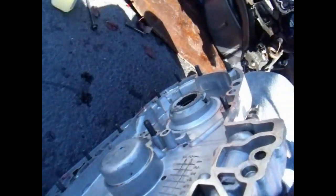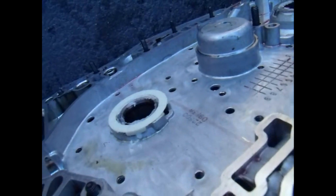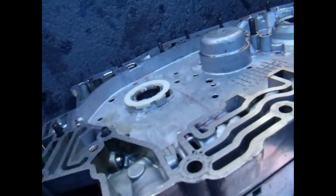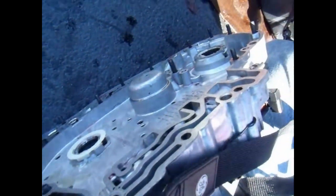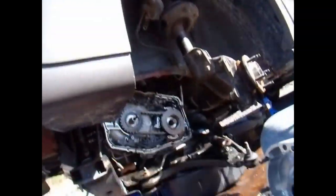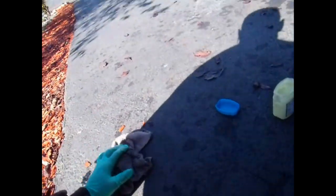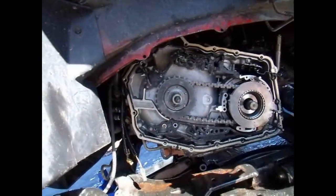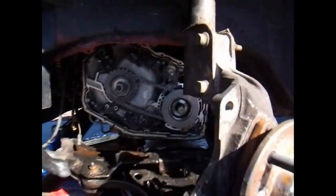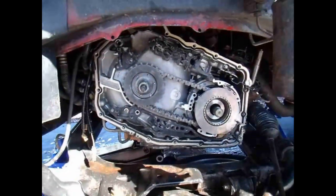As you can see, I've got my two thrust washers on the back of the case cover here, and I'm going to go ahead and put the case on — it's ready to be installed. This kind of gives you an overview of what you're doing there. That will allow you to put this on there. Put some Vaseline on the back to keep it all installed and hooked on there right. Now I'm going to put this on there using my guide as a template to make sure it slides on there correctly.